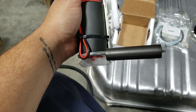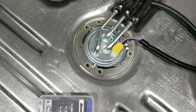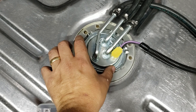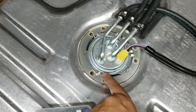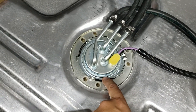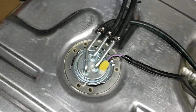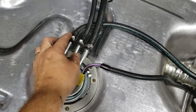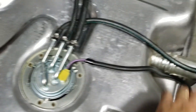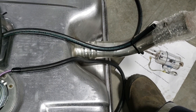Now I have to install this in the tank. So here's the sending unit — the lock ring spins clockwise to install, the tabs go up against the tabs on the tank, and the rubber goes underneath the sender between the sender and the tank. The wiring is all sitting here. I actually used a quarter inch line but made it go on the 5/16ths, and it goes up the filler neck for the vent.